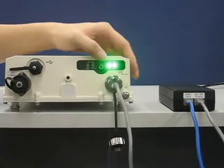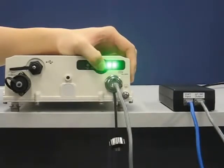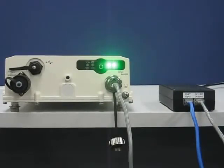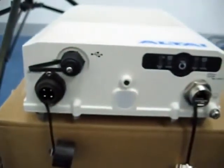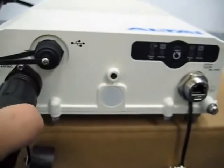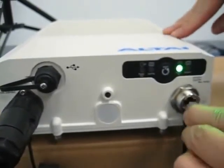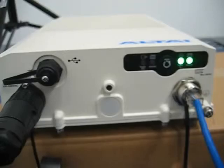This is the hardware reset button for resetting the A8 to a factory default configuration. To reset the A8 base station, press and hold the button for not less than 5 seconds. The power LED will flash twice to indicate the factory default configuration has been loaded. You can release the reset button as soon as you see the two flashes. You can also use a standalone AC power cord to power the A8. After plugging in the AC power cord, the power LED will be on. The activity LED will also blink and show the status of Ethernet transmission once you have an Ethernet connection.